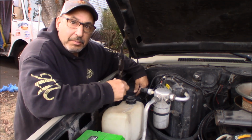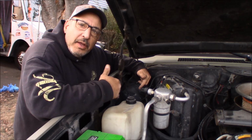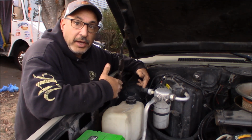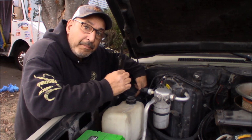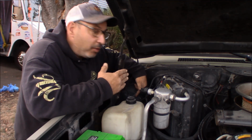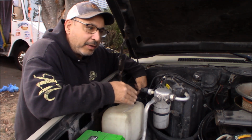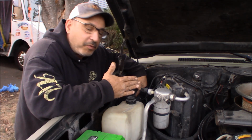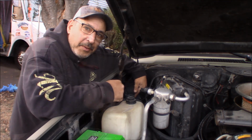Alright, so as you heard, the blower motor has seen better days. For all we know, it could be the original one in here. So not only is it making noise, but the airflow stinks, probably because the squirrel cage is in pieces, not pushing good air. But we are going to pull this blower motor out, and we're going to replace it with one that supposedly is a direct bolt-in, and it'll give a little bit more airflow through these old vents, which weren't great when these were new. I had one of these brand new, and it blew air, but it didn't blow air as good as a modern car today does. So we're going to see if we can get him a little bit better airflow to go along with this blower motor swap. Let me get the parts, let me get some tools, and we'll be right back with you.